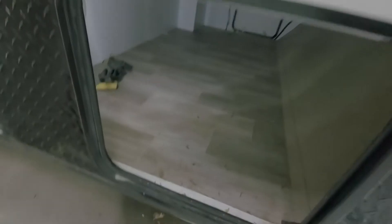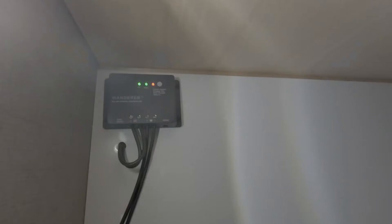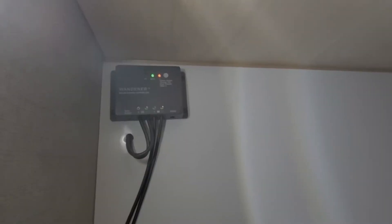The lithium-ion battery and the inverter will be placed inside the pass-through where the solar charger already exists. The wall behind is metal, so I'm able to tap into that using self-tapping screws to mount the inverter and the lithium-ion battery.